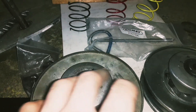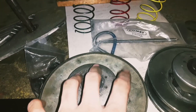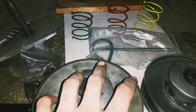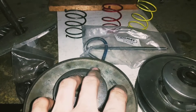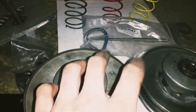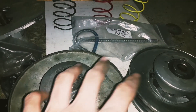This isn't set in stone by any means, but generally to cap things up: for a drag racing setup you're typically going to want a higher stall speed in the clutch and a spring that allows the pulleys to shift from low to high ratio faster. If you're off-roading, you might want a lower stall speed spring but still closer to peak torque — that way it holds the low gear ratio longer and it'll be a lot more driver-friendly.